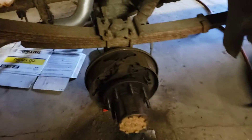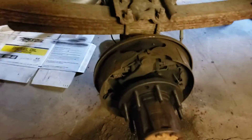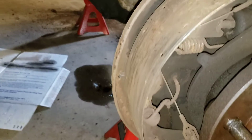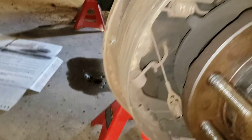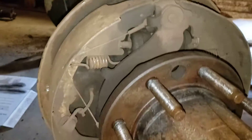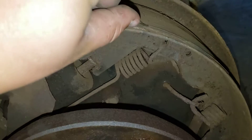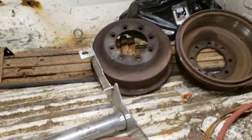There's the front tire — the tires are old but in really good shape actually. Now this brake — this is garbage. You can see there's no liner left on that. There were some chunks on it but everything's so old it was just delaminating. This side is actually starting to fall apart — I could probably pick some of this off. Yeah, that took like no effort. You can see all the chunks of the lining, and there are the drums.